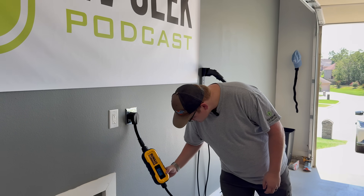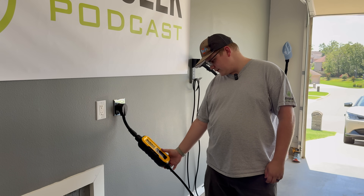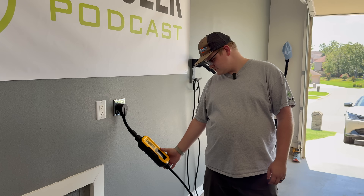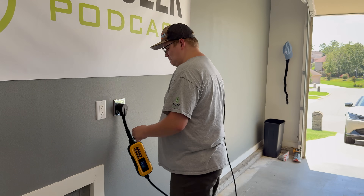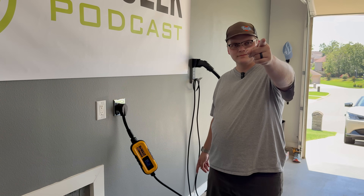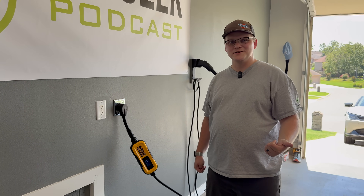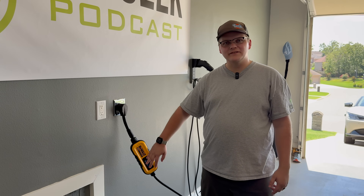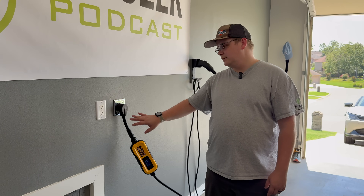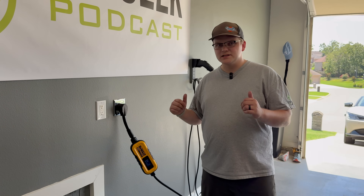It should say 0.1 amps charging and ramp up, but we got a relay failure. After that brief break, we figured out there was nothing wrong with the charger — it was because the car was already at its charge limit, and Joel also had scheduled charging set up. That freaked out the electronics a little bit; Tesla started taking amperage and then cut off quickly, making the charger think there was a fault. We unplugged the charger, plugged it back in, adjusted the settings, and now it shows 240 volts at 31.9 amps, which is exactly what we'd expect.